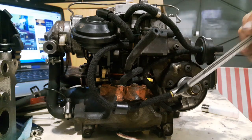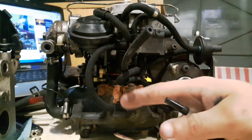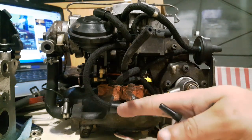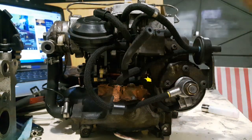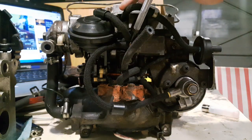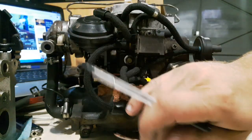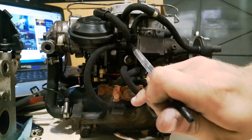Yellow line — dead simple, goes straight round. Make sure if you're taking the old pipe off, you save this plastic spacer because that can stop your vac hose getting damaged against the manifold. Gentle sweep round, and that goes into the side of the overrun cut-off solenoid.